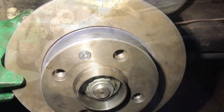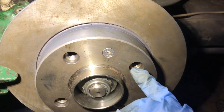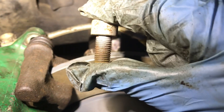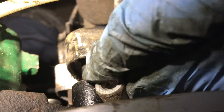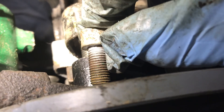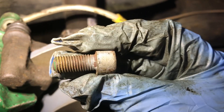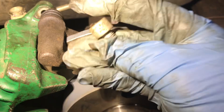Let's get the disc on — lift the disc on with the retaining nut that holds the disc onto the hub. Now bolting on the carrier — these are the nuts that hold the carrier onto the hub, and they're too short. Yeah they're too short, so you will need longer bolts — or hex bolts — with the correct thread. Basically you need longer bolts, probably only about 10mm longer. I'm not going to stop now, I just have two bolts holding it roughly in place, but you will need longer bolts.